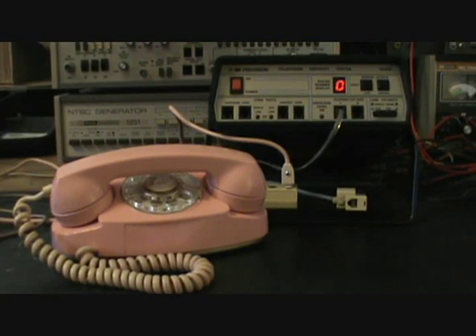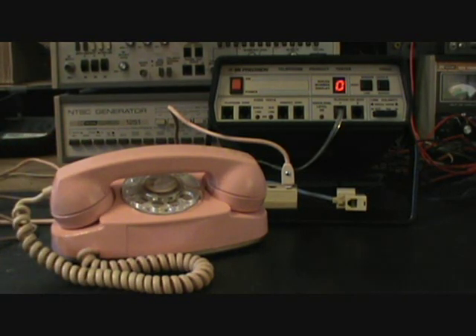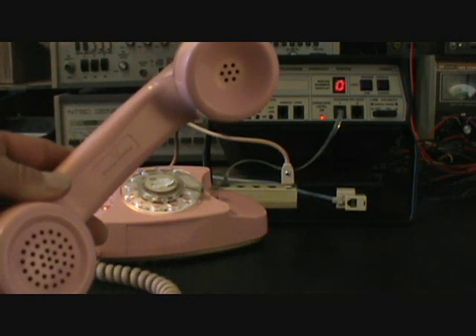We're finished up with this telephone now. We have wired our transformer line into the back of the telephone. We also went through the rotary, cleaned it, adjusted it, made sure everything was dialing properly, and went through all the connections at the network and the block to make sure that was all proper. We also installed a modular port plug so that Ken can plug this telephone into any modern jack. Everything is finished up and we're going to do our final checks. We can't ring this telephone because it doesn't have a bell installed, as we showed earlier, but we can go ahead and do some tests.